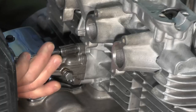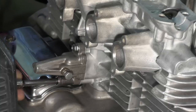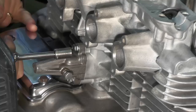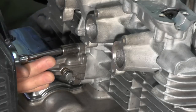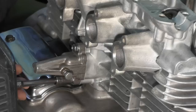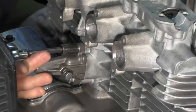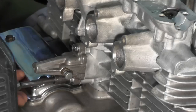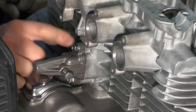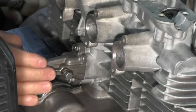This is a clicker type torque wrench. I almost had them there to begin with. So I've readjusted the torque wrench for 60 inch-pounds, which equals 5 foot-pounds. Go back and recheck them — double-click — and we're good. So now I know I've got both of these at 5 foot-pounds or 60 inch-pounds. I'm not going to adjust this back out until I get the top end finished up, and then I'll put tension on the chain. So I've got this component done.